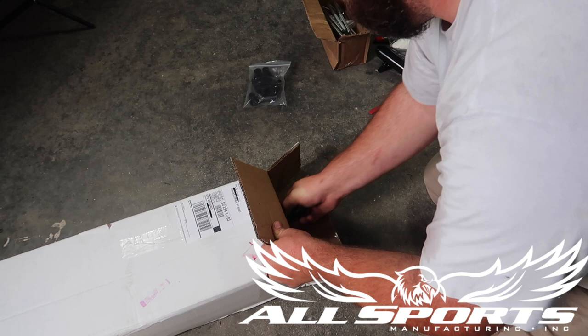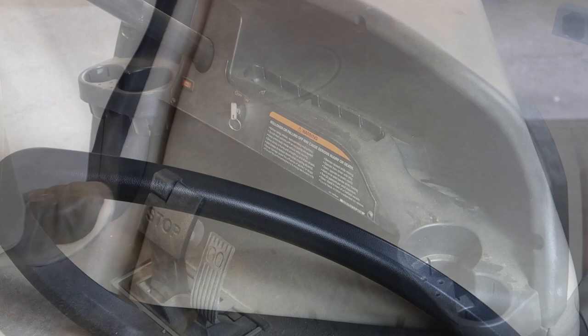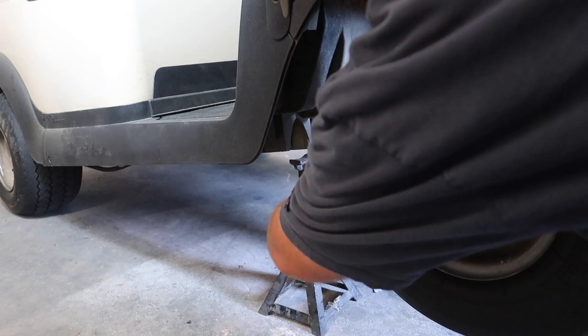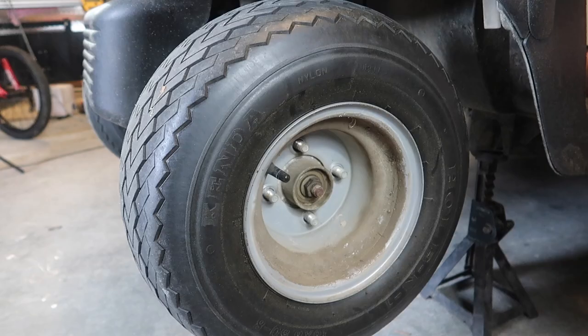In order to get started, we're going to switch the golf cart to the off position and set the parking brake. Next, we're going to place the golf cart in tow mode and pop the wheel caps off. Next, we're going to use a floor jack to jack the golf cart up. We're going to place jack stands underneath the frame rails behind both of the front wheels and tires and release pressure from the floor jack onto the jack stands. I use a 19-millimeter socket and impact to remove the factory golf cart lug nuts, wheels, and tires. In order to remove this front bumper, you're going to need a 10-millimeter socket and a 13-millimeter wrench. There's going to be two bolts right behind the bumper on the frame rails, and once you have those removed, the bumper will slide right off.